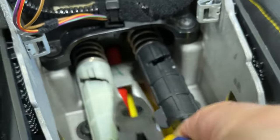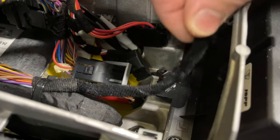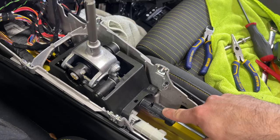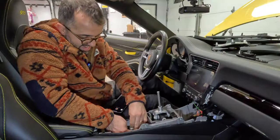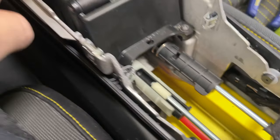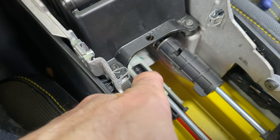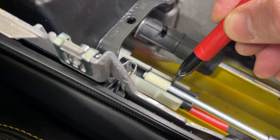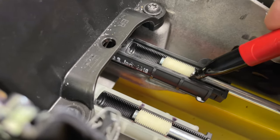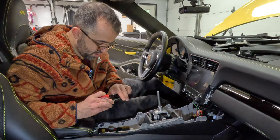Now just by prying it — this is the trickiest piece; in my other car I actually broke a tab, but here it comes right out. Next you've got this wiring loom to disconnect. On this side I simply squeezed at the bottom to pull it out of the hole. The one in the back I had to cut the zip tie. Now that the shifter is exposed, to remove the shifter cables you simply push them forward and slide them out, which exposes the gear. Mark the area where the shifter should sit so you know exactly where to realign it.